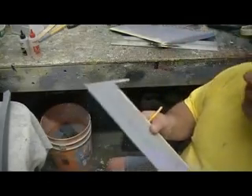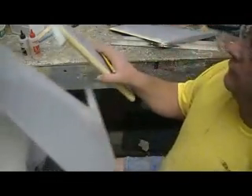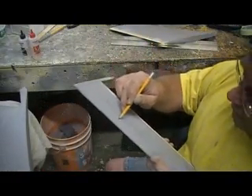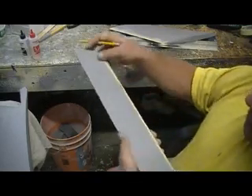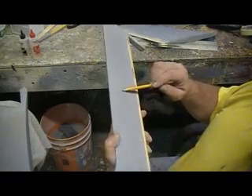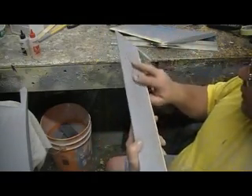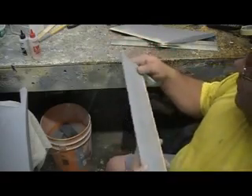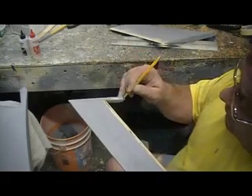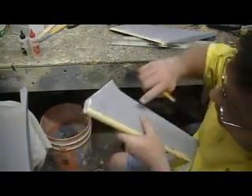I just want to go one more round of filler. Really, that ain't bad — this stuff is just one coat of primer so far and it's looking pretty good. I'm kind of using my primer as a guide coat, so the shiny stuff is low. I've already sanded that pretty hard, so I just need to hit that whole thing with some filler — anything that's shiny is kind of jumping out at me.